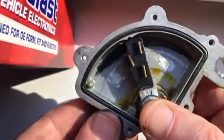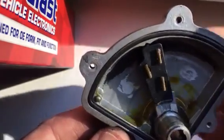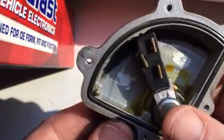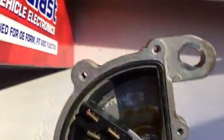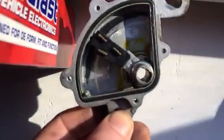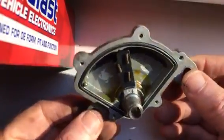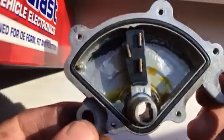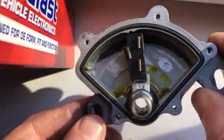When reassembling, it's best to have your car in neutral so it'll be in that detent. Then you use these elongated slots with the meter on the appropriate pins for the neutral position, and slide the whole assembly to make sure it's aligned properly. So there is a bit of an adjustment here — and that's the inside of the transmission range sensor.